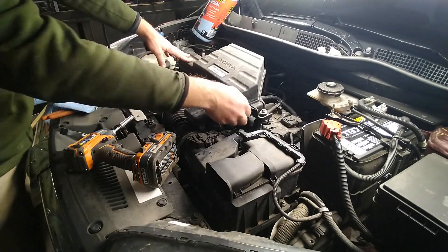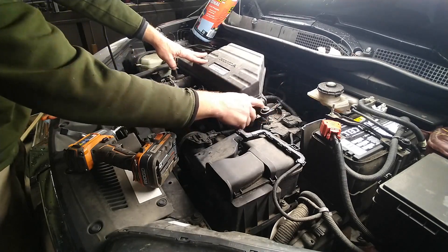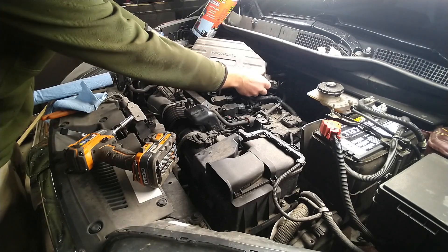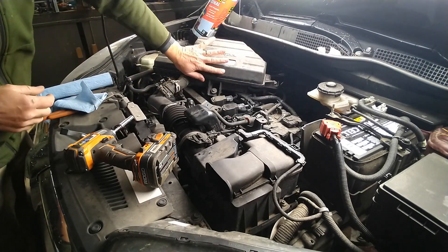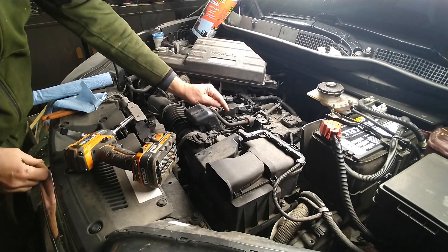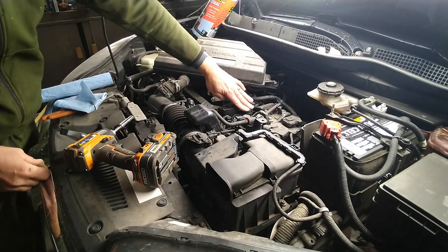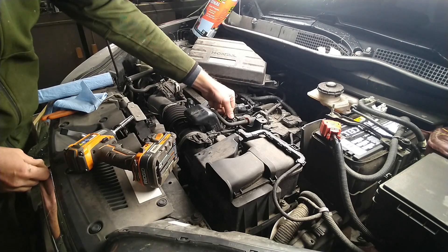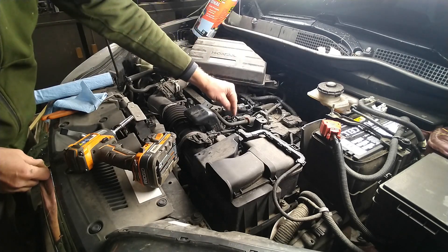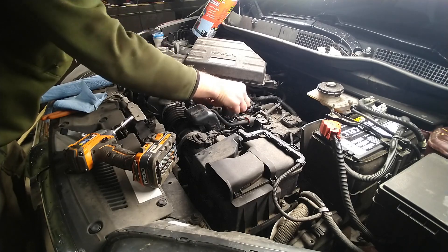The sensors are under here — I've already started these bolts. There's a bolt here and a bolt here to get the sensor out. You just take those two bolts off for this assembly and move it back. This front one is bank one, and the back one is the separate bank. My code is kicking out on this one. These are all 10-millimeter bolts — the two assembly bolts as well as the sensor bolt.